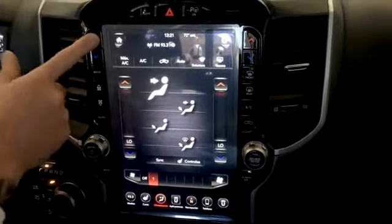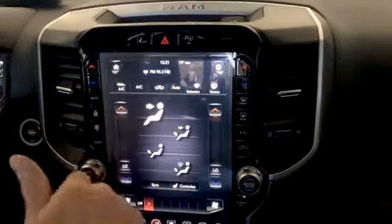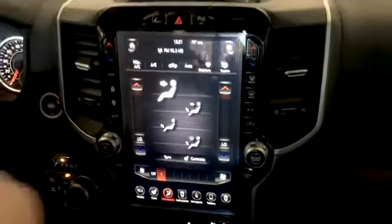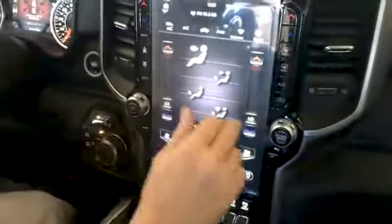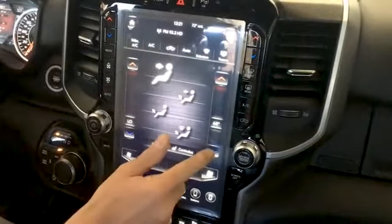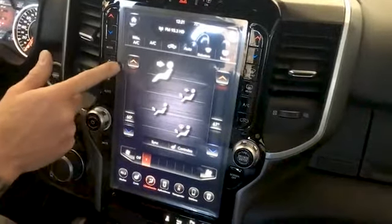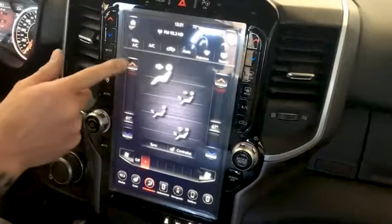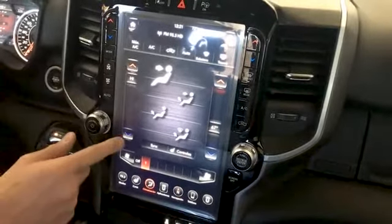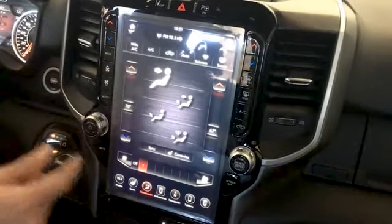And we are basically jumping from high to low, so this usually is an indication that it needs to sync. I did skip that step in programming because the old one had the dual zone already on it, so I'm going to check that setting to verify, but this is something you want to test. Oh, you can see this one's actually going up like it should. So that's good, and now this one is as well. So as you can see, sometimes it just takes a few moments to sync. So you want to test the climate to make sure. It looks like we're doing good there.